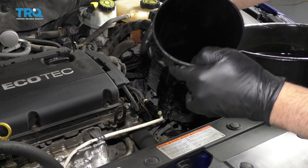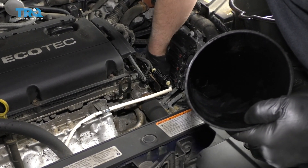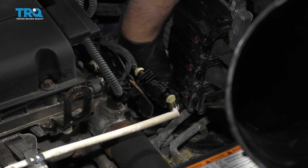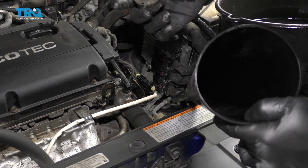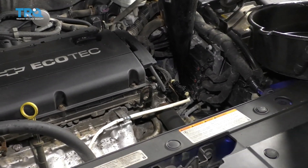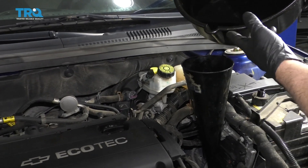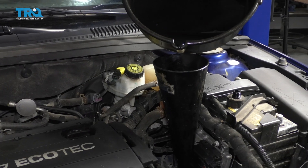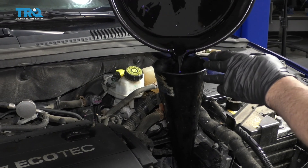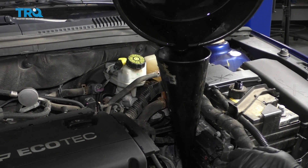After you've done this job, you're going to have to top off the transmission fluid because some came out. Right on top of the transmission there's a fill cap — unscrew it and use a transmission-style funnel. The easiest thing to do is take the fluid that went into the pan and pour it back in, as long as your pan was clean and the fluid looks good. Or you could add about half a quart of the proper transmission fluid.